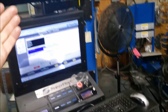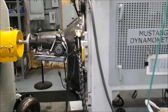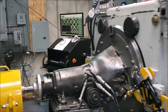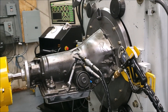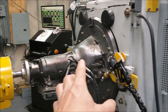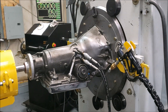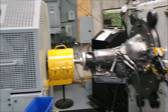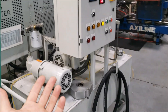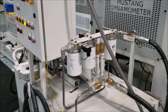We've also got this other one here — this one's got 800 foot-pounds of torque capacity. I do a lot of testing of converters on this thing, which is amazing because it will data log everything. I can simulate a car's parameters: weight, torque, gear ratio, tire size — we can replicate that on the brake here, put the torque in, and test the stall. I can get a printout. All the fluid gets circulated through five different filters and it's brought up to temperature — right now it's 150 degrees.